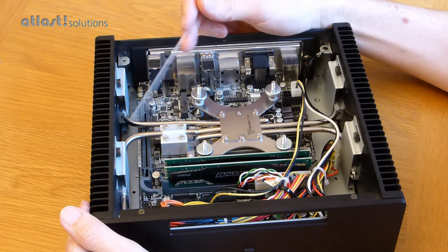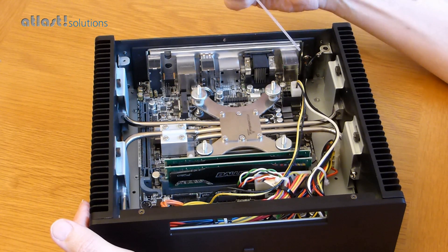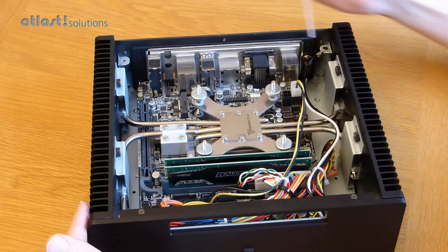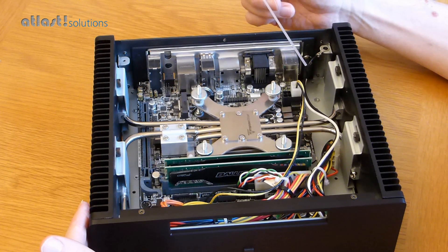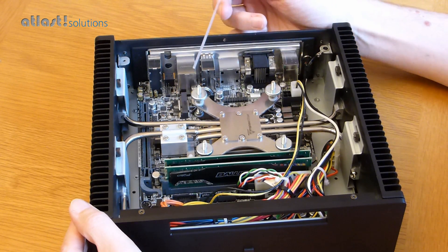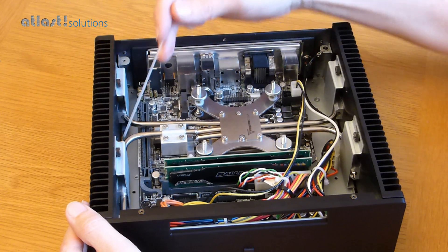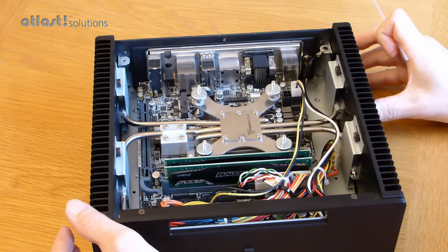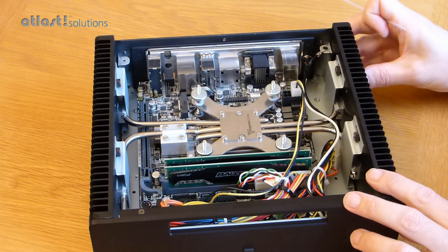More inferior products don't have heat pipes on the chipset, and they would need the product to have air cooling, so somewhere in the product there would be slots that air can circulate through the centre of the case. This product doesn't need that because the heat is actually being taken away down the heat pipe and to outside the case, which means the product is effectively sealed from dust if you are in a dirty environment.